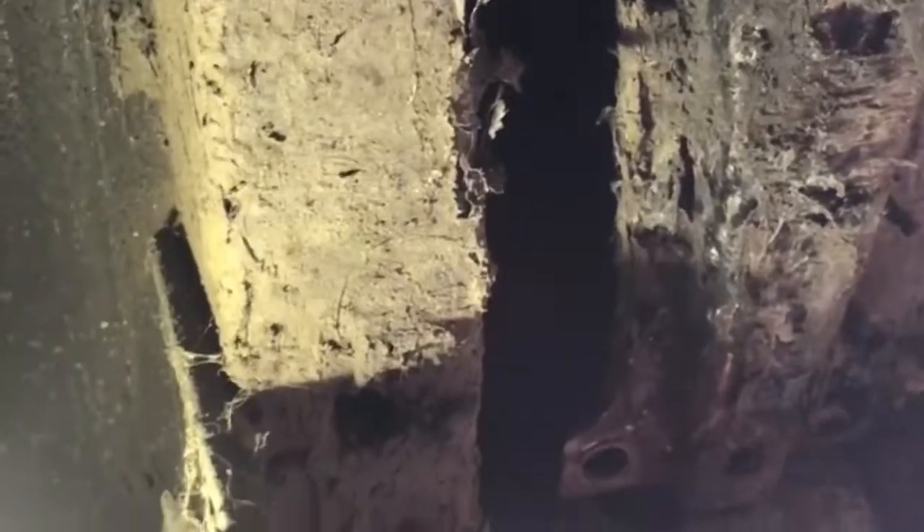That plate on this side I should theoretically be able to tap through once I've got the bolts off. You can see how weak that was — it's just bent back. What a mess, so this does need replacing. Using a crowbar to hold the mounting up while I put pressure on this nut using a breaker bar. I've released the nut itself, and now I'm using an extension and a ratchet — it's coming off.